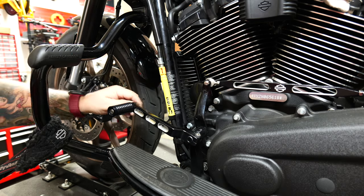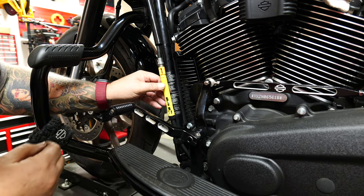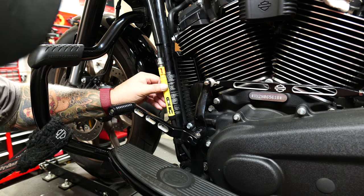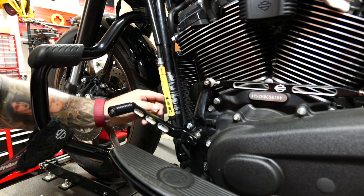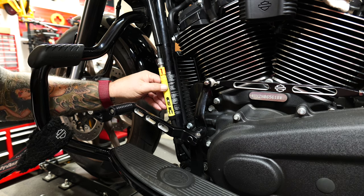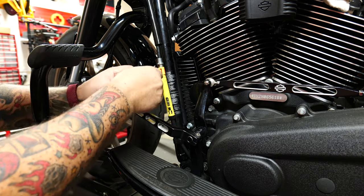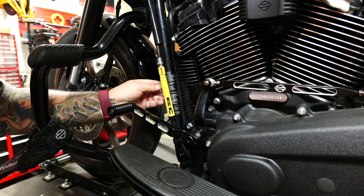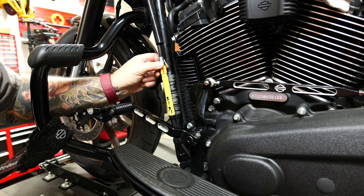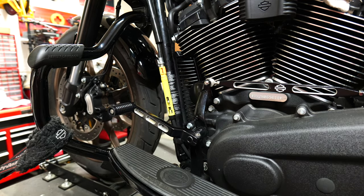Push it all the way down, push that back in, and now your cable is sloppy so you can work on this area to get the upper clutch cable disconnected. On the backside as you spin it around, you've got a little connection and a little tab. You have to bend that tab up with a screwdriver to release the ball so it comes out. Pry this little guy up like that — you can see the ball is now loose. Then push it out from the backside to get it out. Now that's loose and removed, freeing up that cable to be pulled out.